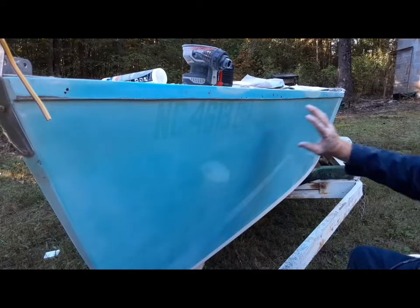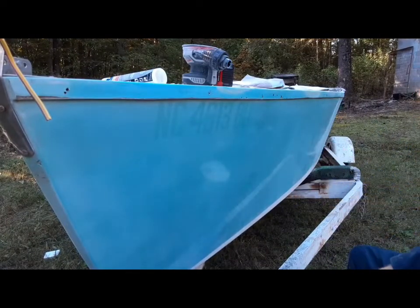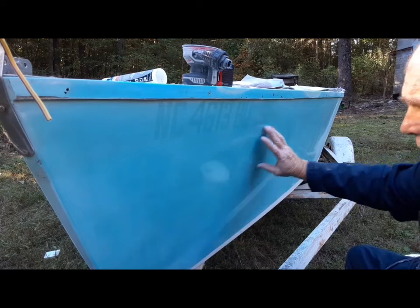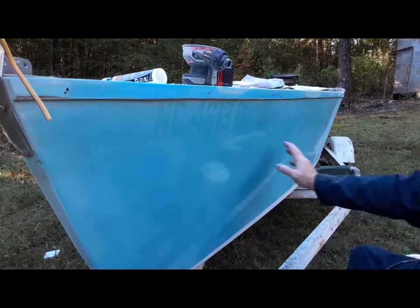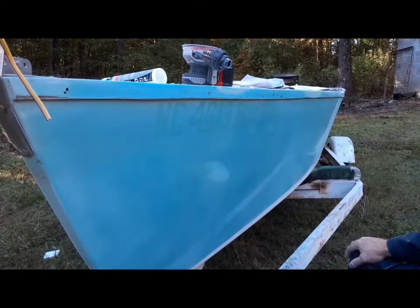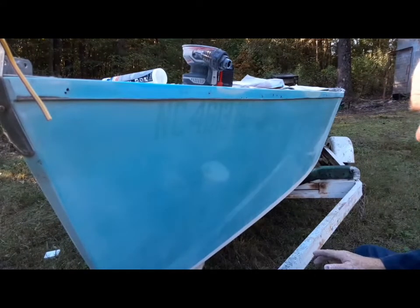This will continue sanding in the 5 to 6 stages of abrasive all the way down the port side of the vessel. Then the buffing will go down the port side of the vessel. Then it will be time to wax it. Do not wax it in sunlight.